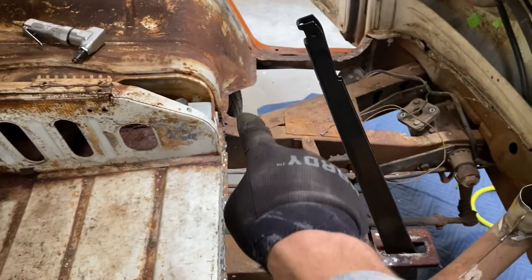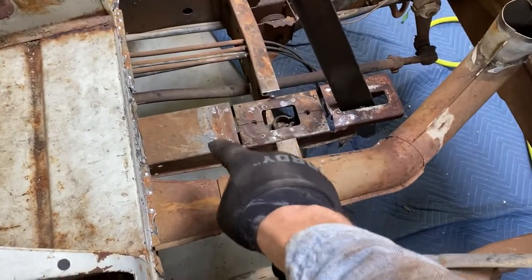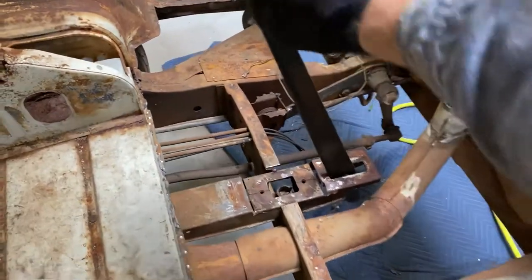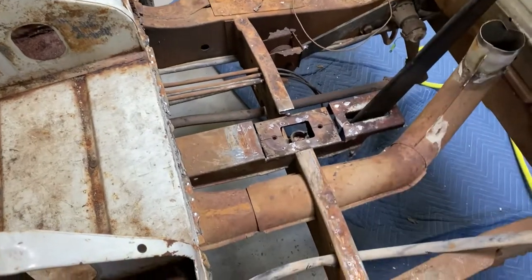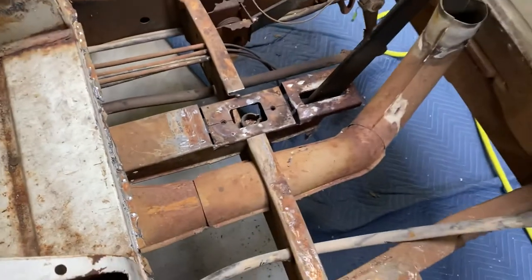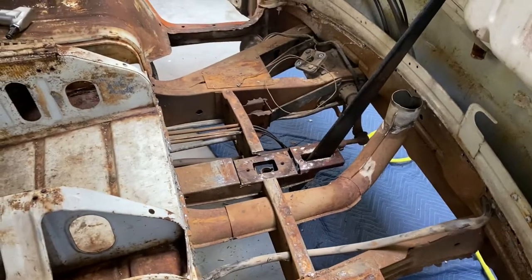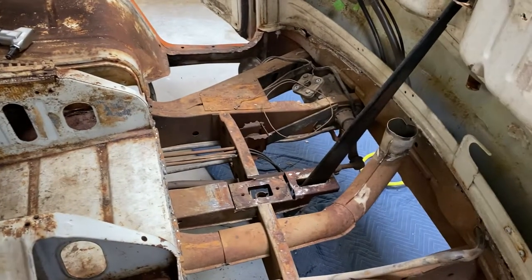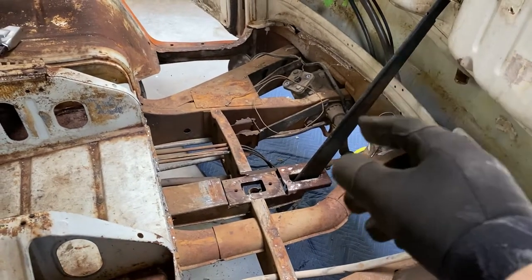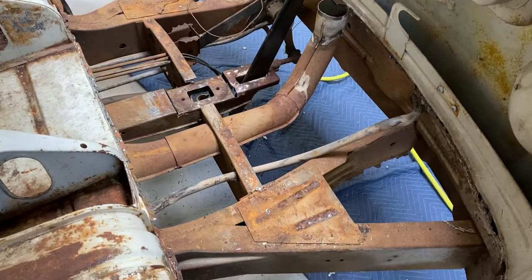On the driver's side wheel arch as well, you have probably 12 welds in the center portion area that retain the center of the front pan down along the emergency brake lever area. This here is the hockey stick linkage for the shifter. Still need to drop the steering box, disconnect it with the pitman arm, get that off the drag link, and drop our clutch and brake levers.